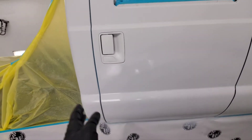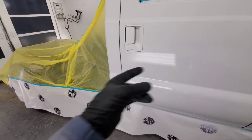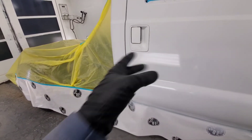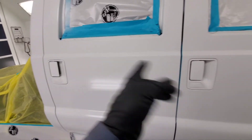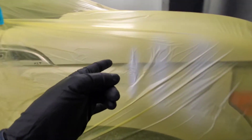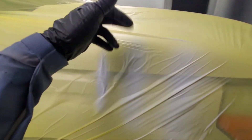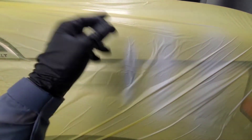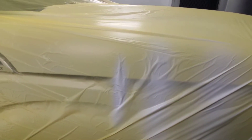So I kind of went a little bit further than I did with the sealer and just blended it up. Trigger a little bit, pull it back and trigger it off just to feather it out, all the way up. The top one I can just go right across because it kind of feathers out. I had it a little closer than I usually do, but you can see it fades up in there and it's more heavy in the middle. That's the idea of using your gun for a blend — the blend is already kind of built in and it'll fade out nicely.